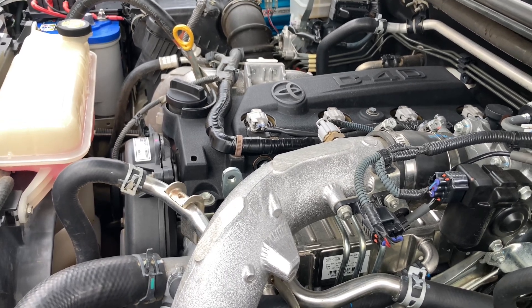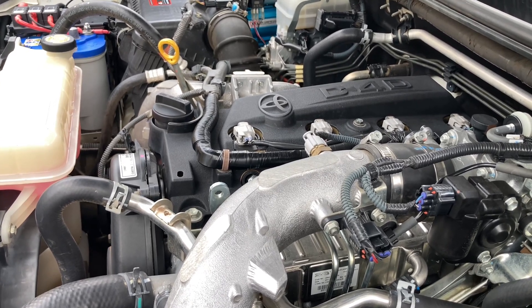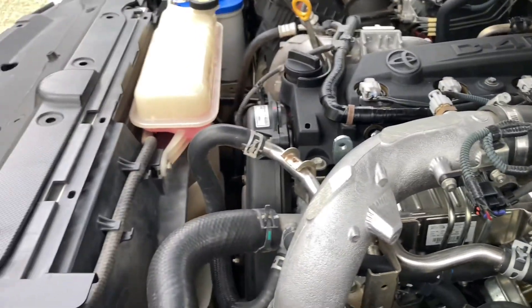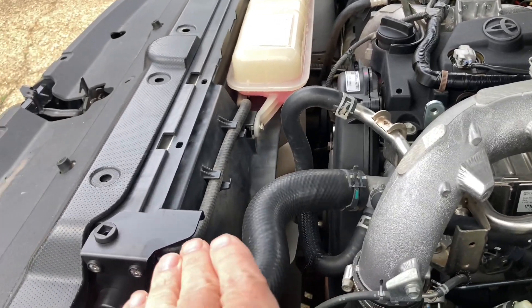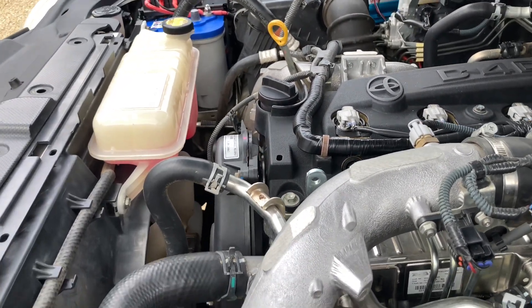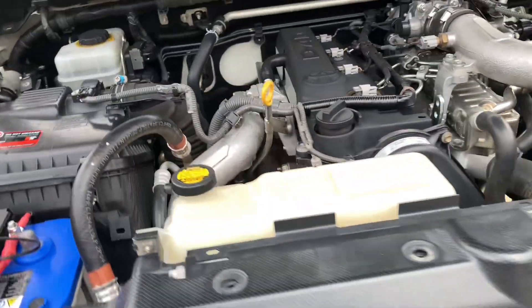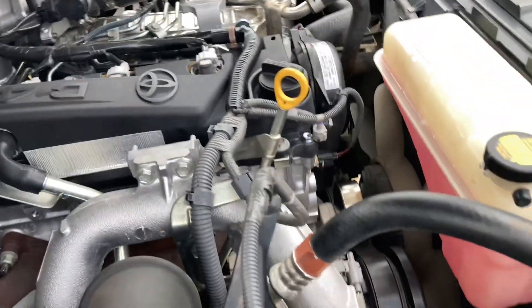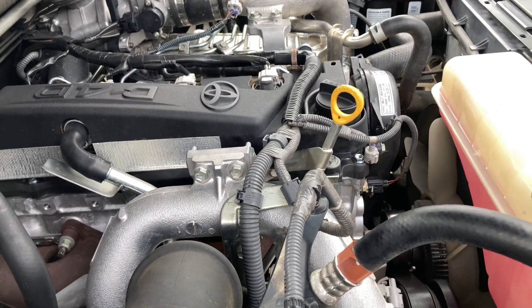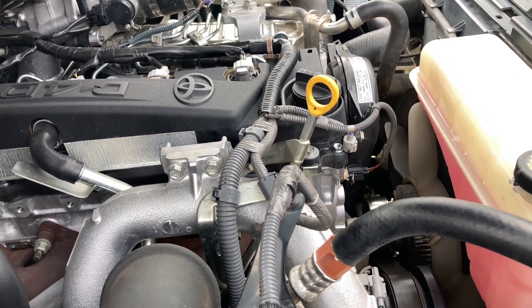Personally, I don't like to see more than about 87 or 88, but that's okay. I think of 90 as a real limit, and once you start going over that, you've got to ask yourself questions. Is everything operating satisfactorily? Is the fan working if it's in traffic? Usually the fan's fine. Is your radiator clear and flowing, allowing heat transfer and doing its job? Keep your coolant nice and clean at the right level. Rarely are you going to have a leak that causes any sort of overheating problem — that's going to be rare. I don't want everyone panicking, going 'mine doesn't run at 85, I need to go get a thermostat,' because a lot of these vehicles are going to run around 87 or 88.